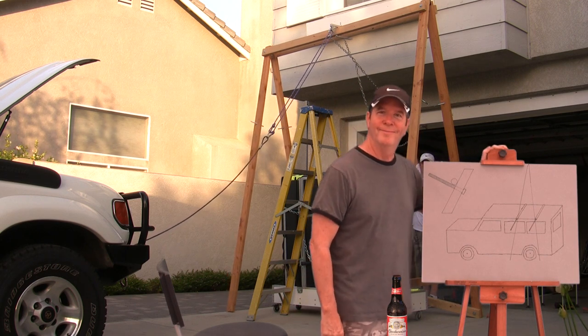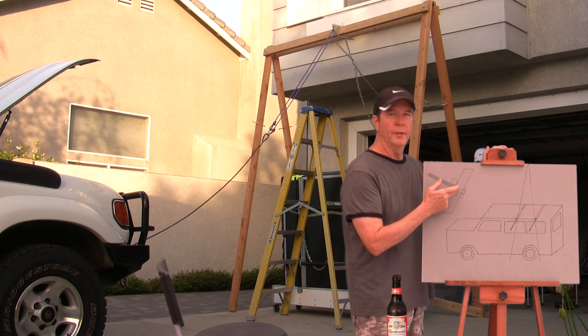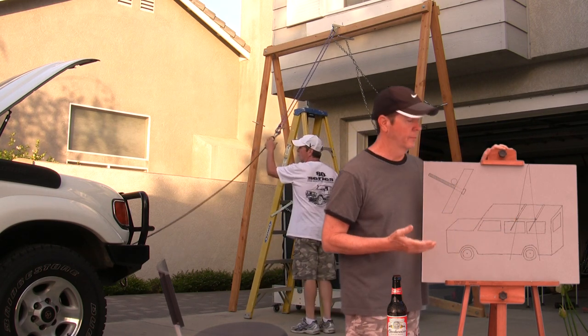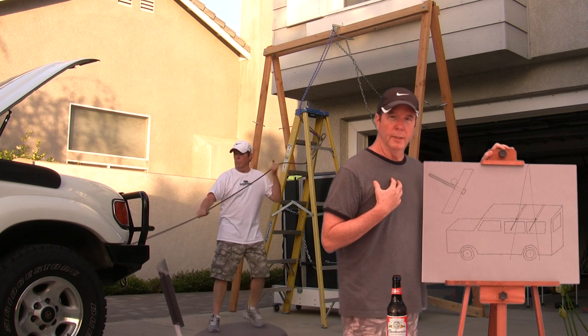It's a clown car. All right, now once you lift the tent up and put it on the rack, the only thing that holds it in place are those 3/8 inch bolts going through the 2x4s. And telling you exactly where to drill those holes is impossible because I don't know what kind of truck you have, your suspension, your tires, all that's variable. What I'm going to do is tell you how I did it.